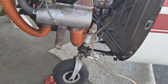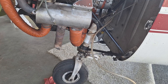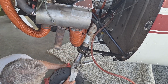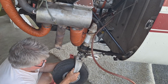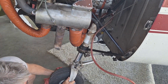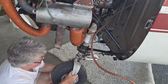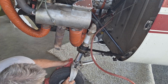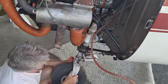I've put a sandbag on the tail and I'm going to extend and retract the strut, watching this plastic hose to see when it's clear. You can see it sucking oil in. When the hose runs clear, I know that it's fully serviced.